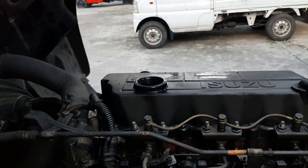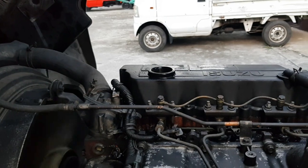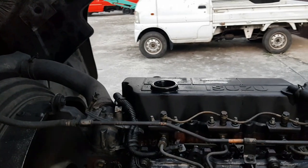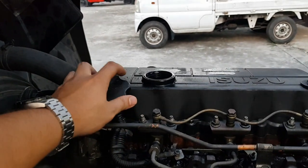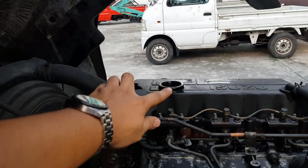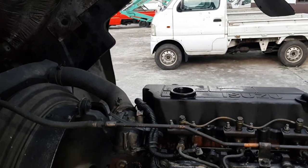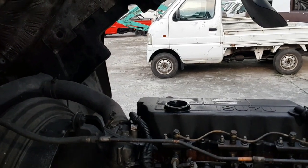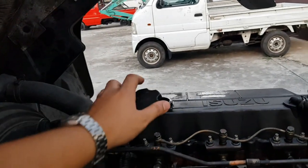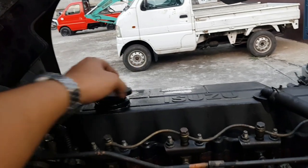Sometimes there's a little bit of splatter — that's okay since the vehicles aren't brand new — but it shouldn't be excessive. Too much splatter is a bad sign. Also watch for smoke coming out, because that means the liners are already gassed up or the piston rings need replacement. This one is very clean — no smoke, no oil splatter — so that's a very good sign. That's number one to check on diesel engines, especially trucks.